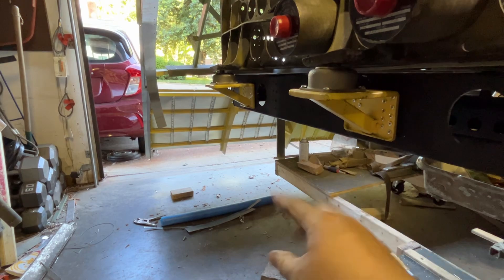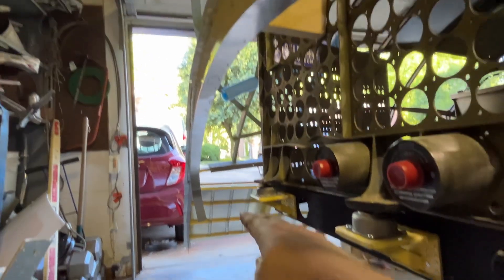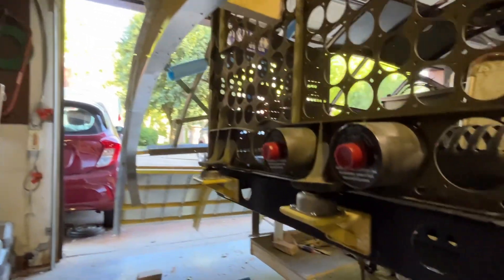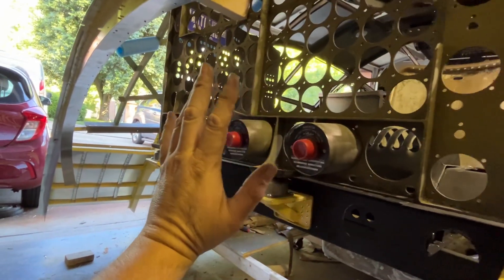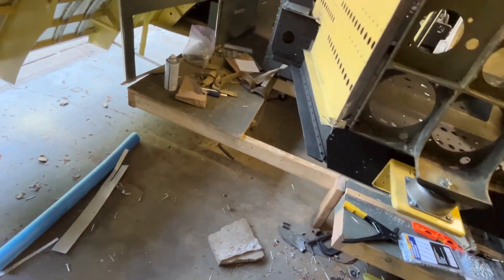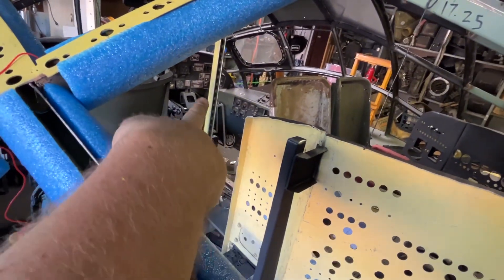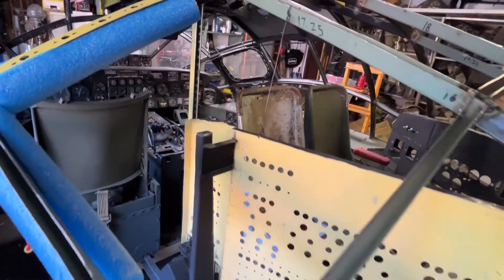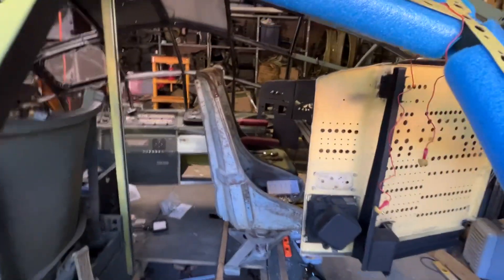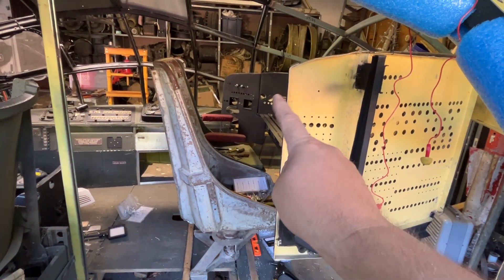Under here you're going to have triangulation about every six to eight inches — a three or four part piece of triangulation that braces here and takes you up to there. That shelf will then attach to this detachable fairing which is rounded, goes up, and ties into bulkhead 3.0, making that massive fairing that goes all the way around. I still have another six to eight inches worth of panel to build there — or rather it's a storage bin, an ergonomically and aerodynamically formed storage bin with a door on it, where the air hose for the flight engineer's D2 goes.